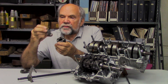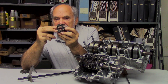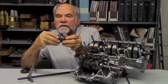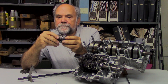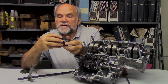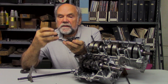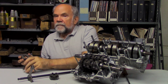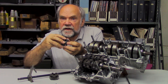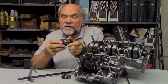Inside the engine, engagement of one gear to another — this is a free-spinning gear, and this one has splines inside of it. The engagement takes place when one set of dogs is pushed into engagement with another, and the two gears now rotate as one. This gear has six dogs; this gear has three dogs. The space into which the engaging dogs can fit determines how much time there is for the shift to complete. So it is better for rapid shifting to have fewer rather than more dogs, because the wide space allows more chance that the gears will promptly engage than when you have twice as many dogs and the space between them is so small.